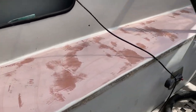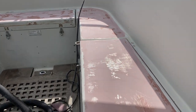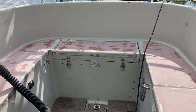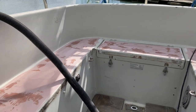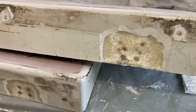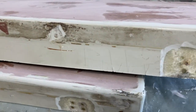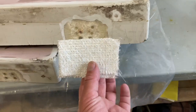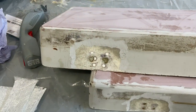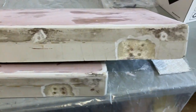That's the sanding of the second fill done on the cockpit. It's got the odd low spot but most importantly I wanted to knock down any high spots — I think that's probably going to be okay for now. There's a big high spot at the back but that is in the original moulding — I'm probably going to have to take some of the height off it just to get the new decking to sit flat down. As you can see here, I've just ground back the damaged area that I highlighted previously on those four bits of locker lid and I'm going to lay up a little bit of glass. I've pre-cut some little pieces of combi mat again, so I'm going to wash those in there with a bit of resin, then sand it back once that's gone off.